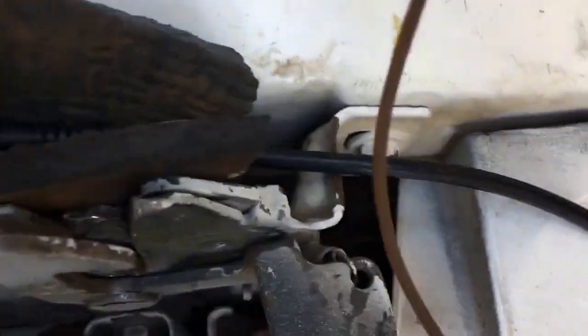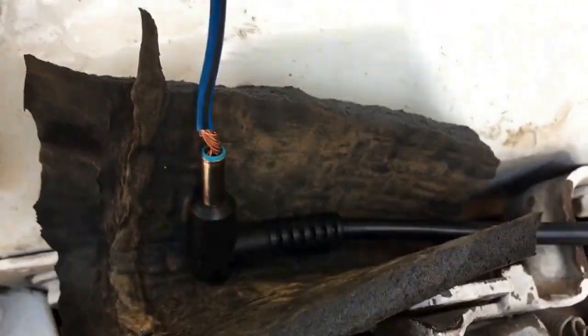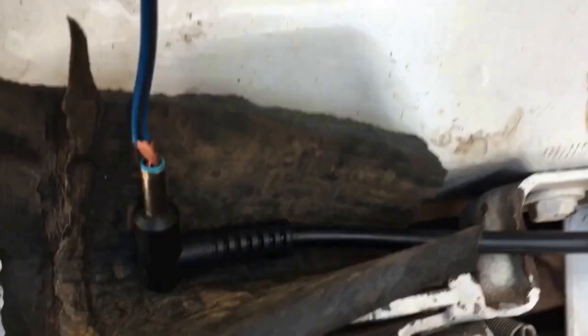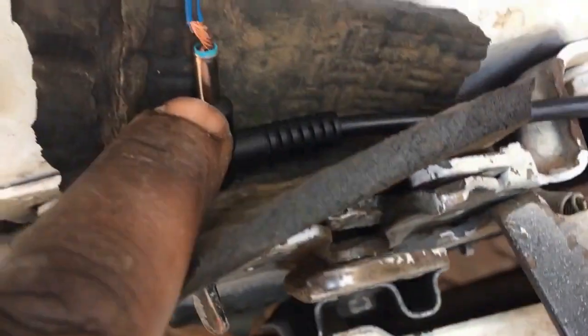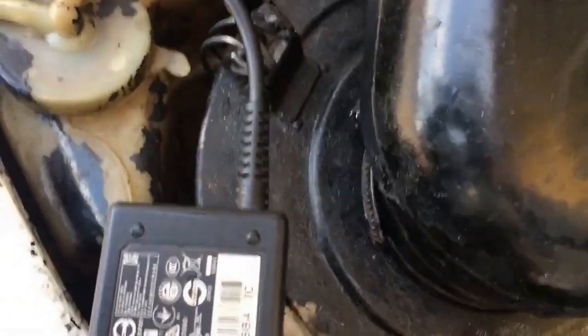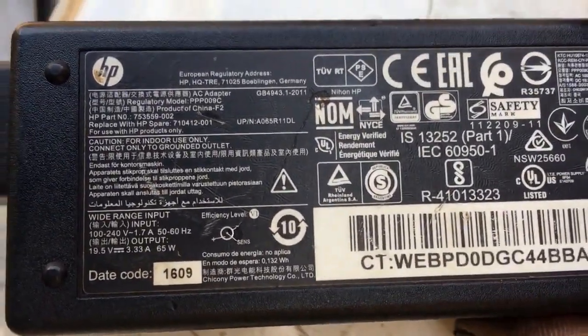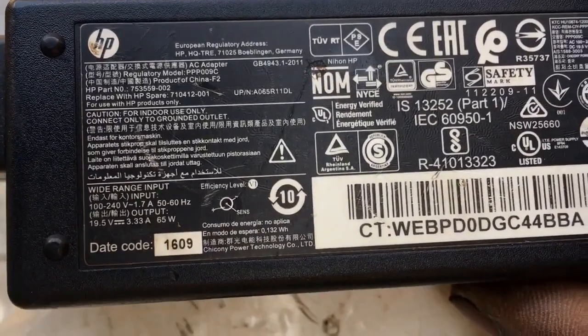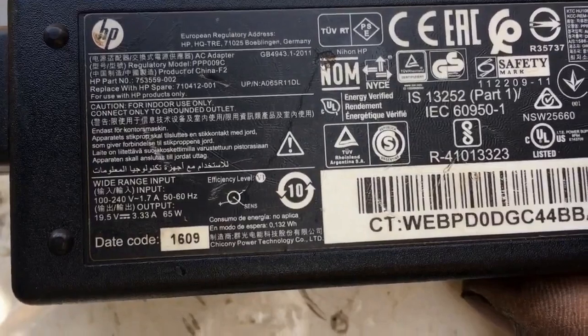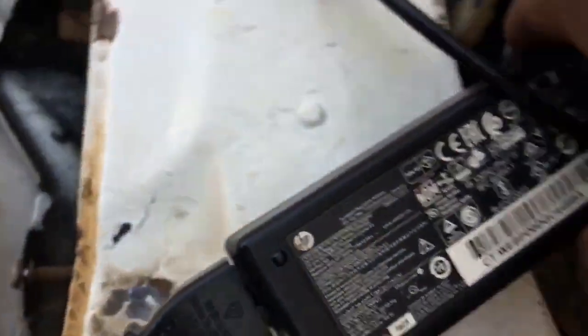It's already connected from the house. I've connected this wire inside the little pin of the charger. The blue ring that you see is a plastic ring that insulates and separates the negative side of the connector from the positive side. The positive side is located on the inside of the connector; the negative side is this big outer one. This charger has an output of 19.5 volts. The wide-range input is 100 to 240 volts at 1.7 amps, 50 to 60 Hz, and the output is 19.5 volts at 3.3 amps, or 65 watts.